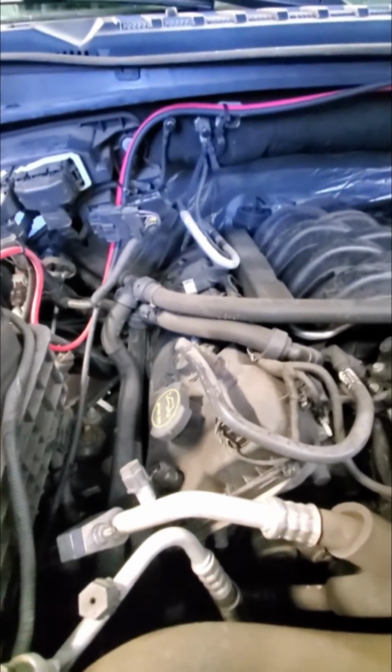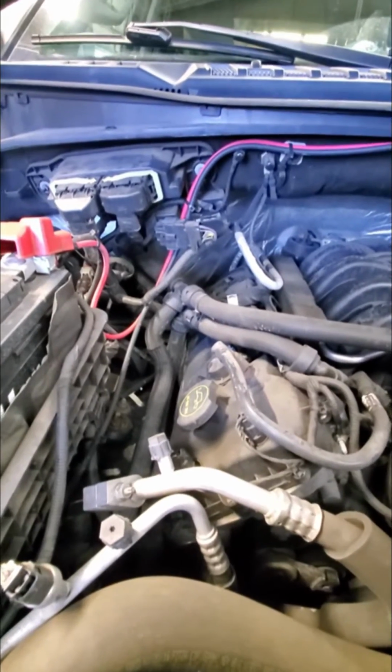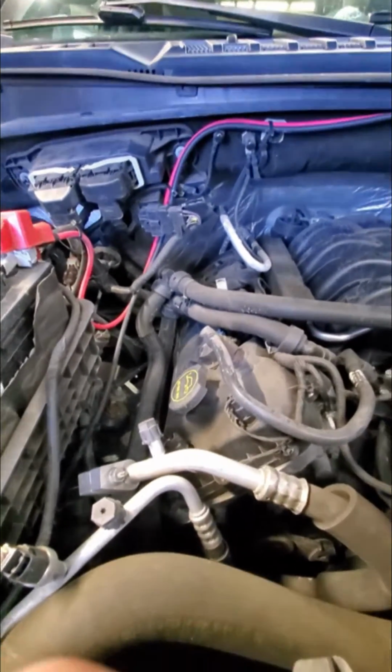Next thing I'm looking for is a leak, because a lot of times air pockets develop from leaks. And looking at the bottle here, this bottle actually has no coolant on it. See how low that coolant is? I'll put it up in the air and check for leaks, because sometimes those leaks have some funny things on the engine here. But I can at least rest assured the heater core is not clogged, not restricted.